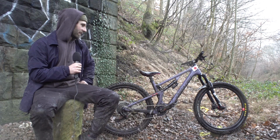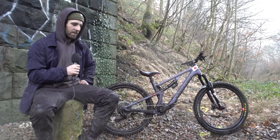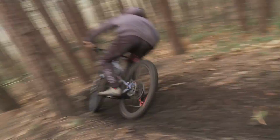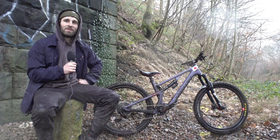Like my base pressures, like I said, I go for 30% sag on the shock, that's just always been my base. And then I get it to where it's not feeling too bouncy, so hit a few runs. If it's feeling too squirmy, then slow it down a bit. And yeah, just try and keep it the same for every track really. If it's steep, I put a bit more pressure in the front just to bring it up. I've never really looked too much into it.